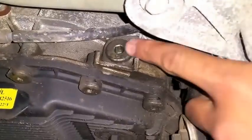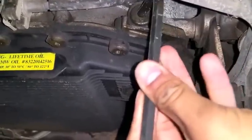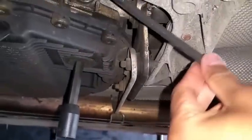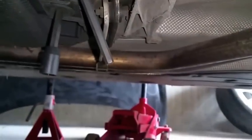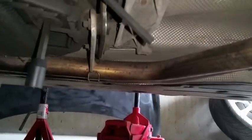I'm under the car right now. At the top you can see the fill bolt, which is opened with an 8mm allen key. Get your allen key and make sure you jam it in all the way inside — it's not halfway, it needs to be fully inside. I already loosened mine. If you get confused, you're turning it towards the back wheels of the car. After you have the 8mm allen key in there, you can use a regular wrench for leverage and just get it open.